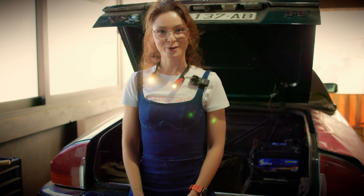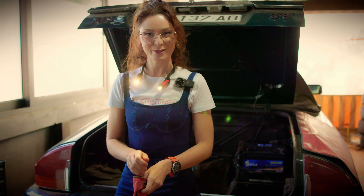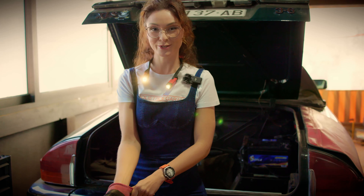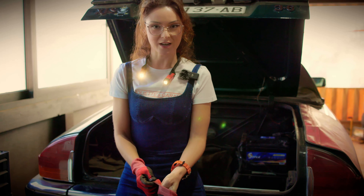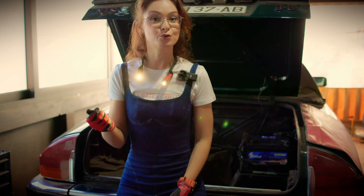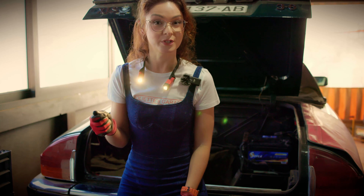The reason why we go for the fuel pump is: when you work on old cars, there are not so many things which can go wrong, and the fuel pump will be the next logical step. And when you try to start the car and it has an electrical fuel pump, you should hear it — and I didn't.